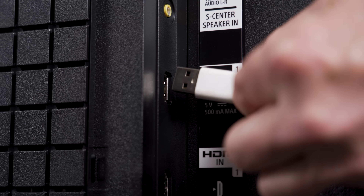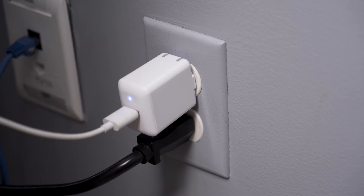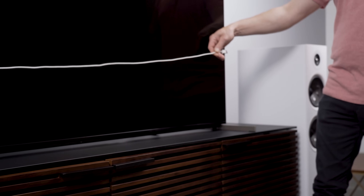First off, I'd suggest getting a longer USB-C power cable for your Chromecast. The hotel TV or connection bay next to it may have a USB port, but it likely doesn't have enough power to juice up your Chromecast. You're almost always better off plugging into the wall with the little wall wart it comes with. However, a reachable power outlet may not be close to the TV, so a longer cable lets you plug into a socket well away from the TV if you have to. It's a nice bit of insurance.